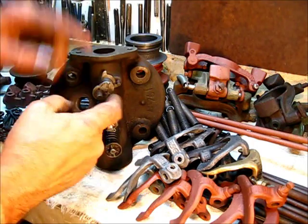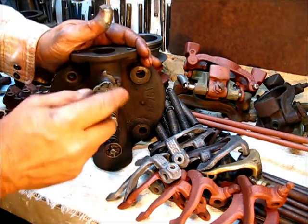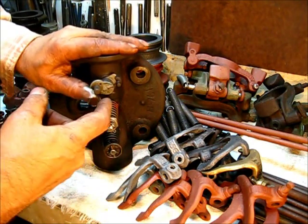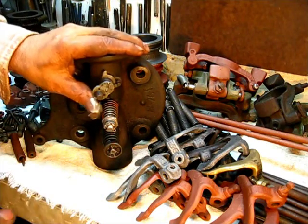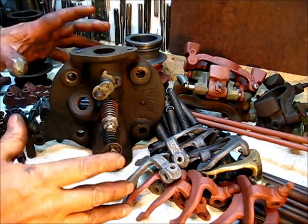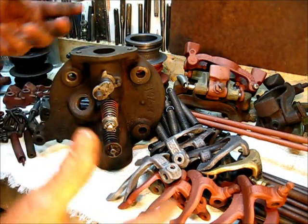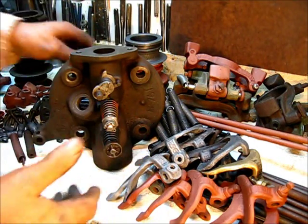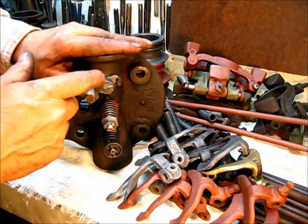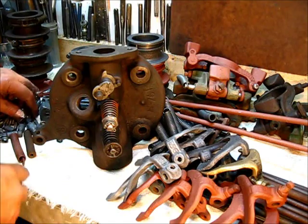There are two holes in this mechanism. This spring right here — you can replace it, take it off and put it back on without removing the front of the engine. It just spirals right around and goes on really easily. You can set it for more or less tension. This whole system works in unison, and sometimes you'll need more tension here to compensate for roughness on the shaft. You may need to set it in the stronger or weaker position depending on conditions.